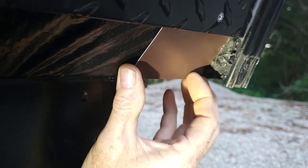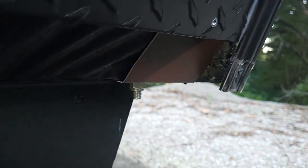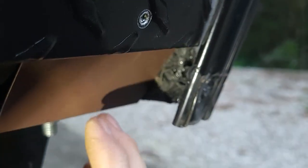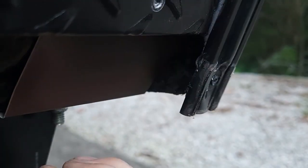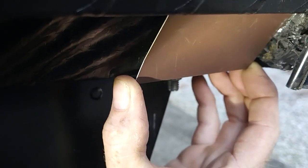My hope is that I can get this as tight as I can on both sides and still be able to get it in. Now there are two wires that come down out of the floor right here — these two wires come from the SAE port on the driver's side. We'll have to notch our little deflector to go around those two wires, then seal that back with some good sealer once we're done. Those are the only two obstacles: these two wires and the corners of this trim that come down. Let's go over to the other side and I'll show you how to get this cleaned up so you get the most room possible.